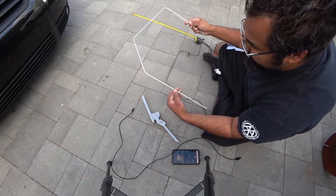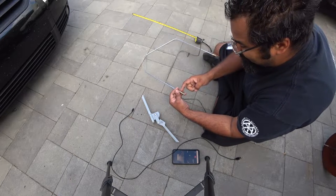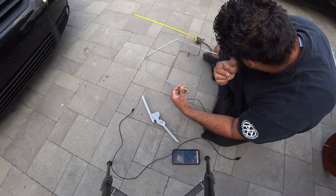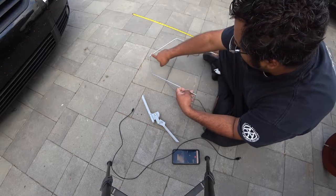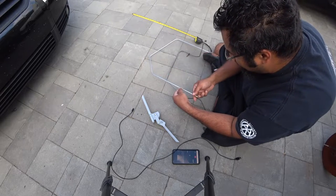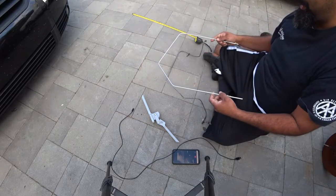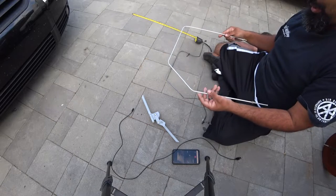As something you need to remember while doing brake lines: make sure you keep the actual screw point out of the way. You do not want it anywhere else. I kind of screwed up earlier and did a bend with it over here — I had to unbend it to get it back. So always keep this on the end as often as you can for your reference. Now we're going to put this back in the car and figure out where we need to do our bends.